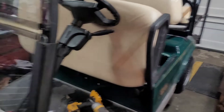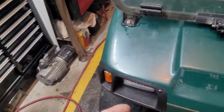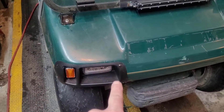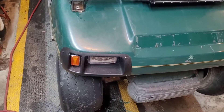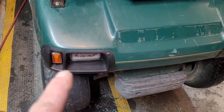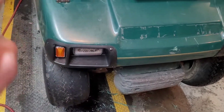So I had to hog that hole in the body again. All the other ones are mirror images of one another — get the template, drill yourself four holes, get a saw of some sort, cut it out, and then you just keep creeping up on it. I like to make it a little bit smaller and creep up on it so it fits in there nice and tight. The rear tail lights are installed but they're only mounted in the body.